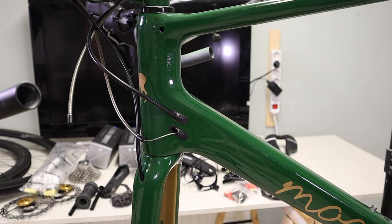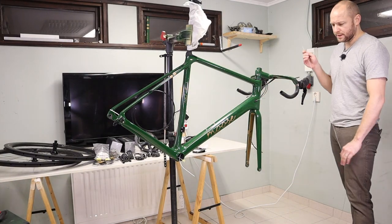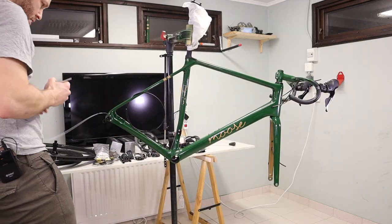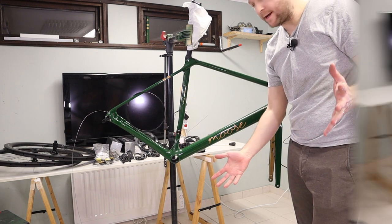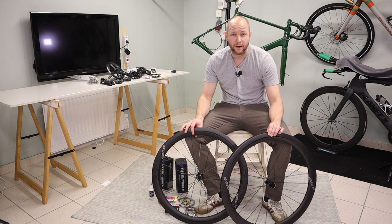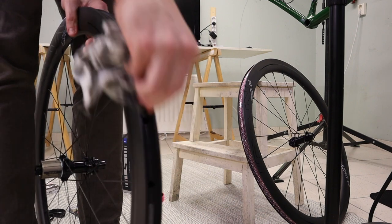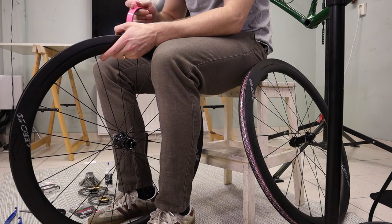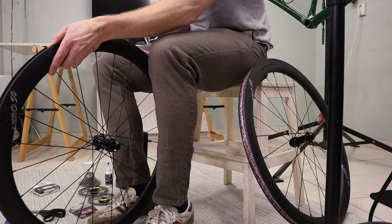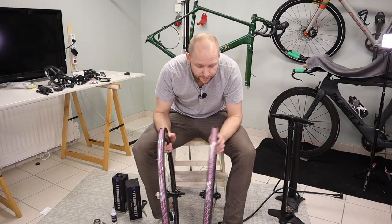The cable routing is done. I'm gonna fit the wheels - although not to the bike just yet - it's always nice to have them ready. Now before I tape the rim I clean the bead, using some washing alcohol to get it really nice and clean. Then I take the valve hole as a starting point and begin taping about 15 centimeters above it. The tape is in place and I think it's gonna be very good.